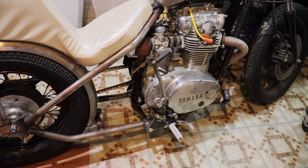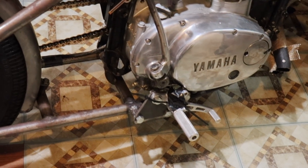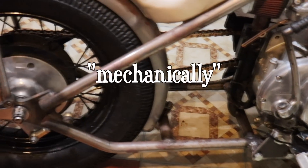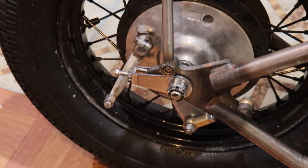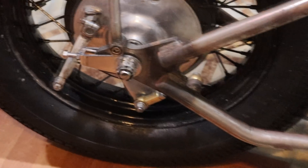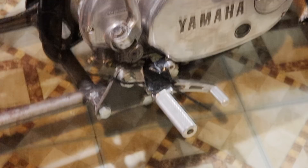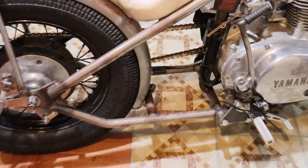For those of you who aren't familiar with how drum brakes work on a motorcycle, they are not hydraulically actuated — they are manually actuated, which means there has to be a physical rod going from the lever that actuates the rear drum brake all the way to the pedal. That's the part I'm going to be attempting to make today.